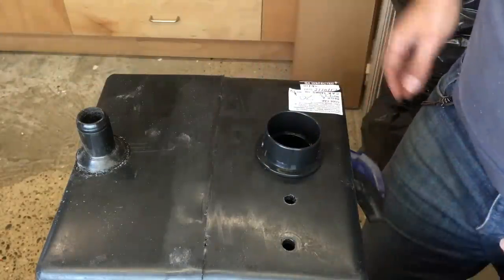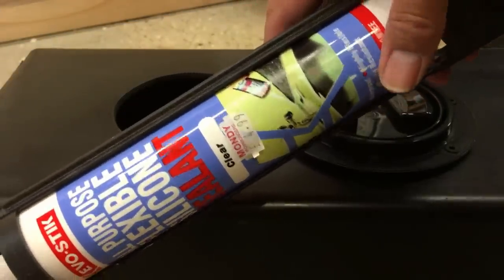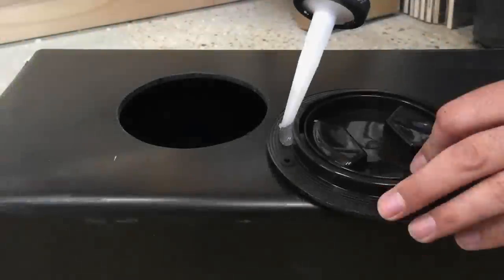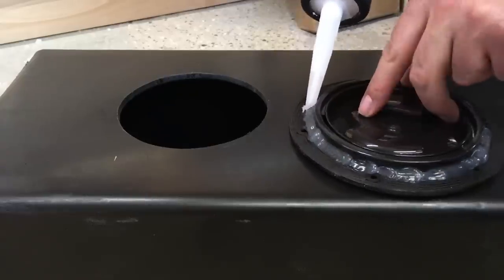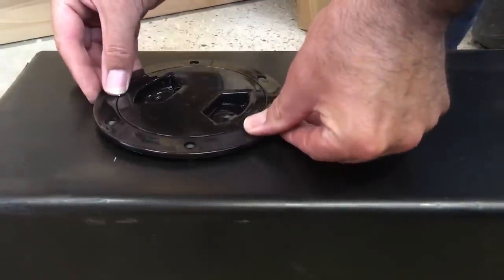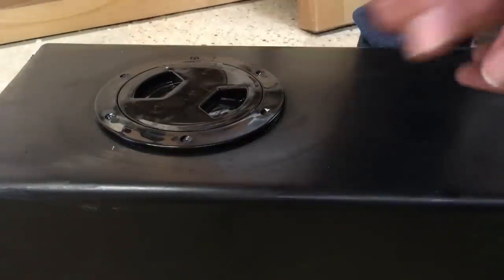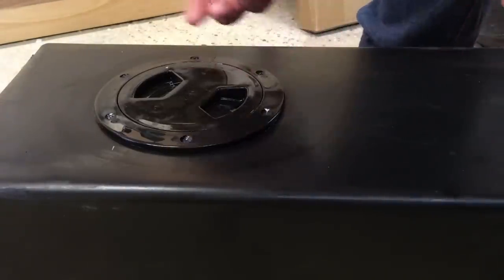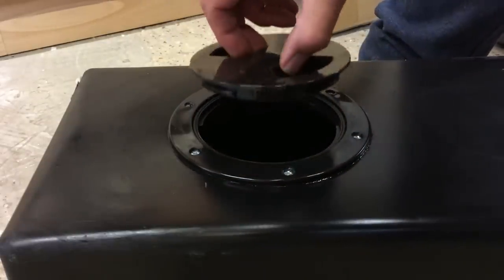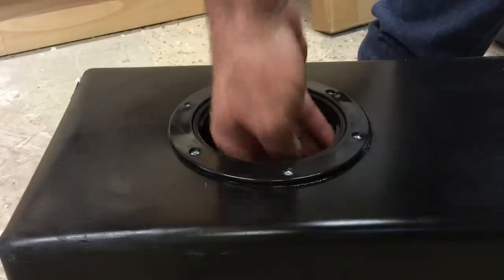This is definitely a recommendation that's going to be worthwhile doing. I've just got a tube of all-purpose silicone sealant, which you'd normally use for sealing round baths and showers - it's waterproof, highly flexible, and mould resistant, so perfectly adequate for this wastewater tank. Once that silicone's gone off it'll be completely watertight. The flange is secured with some stainless steel screws, so that's going to give us great access into that tank if we ever need to clean it out - I can drop it off from underneath, open that hatch up and literally swill it out with a hose.